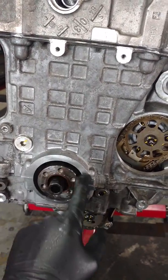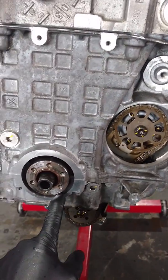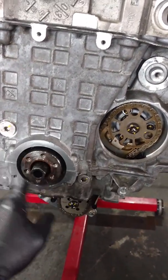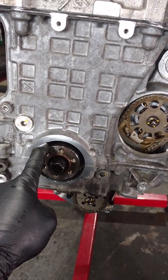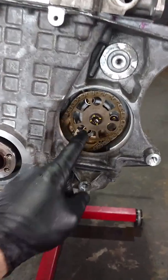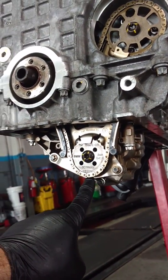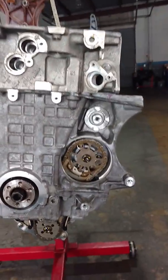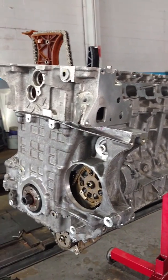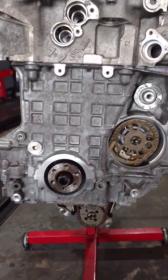When the belt breaks, it wraps itself around this crank seal and goes into the engine. There's a big harmonic balancer that sits on the face of this, and when it wraps itself around, it sucks down to the center of the seal and the seal gets compromised. The belt goes through there, and then the timing chain acts like hungry hungry hippos and sucks it into the engine. After it gets sucked in and goes through sprockets, it gets chopped up like a blender and plugs the oil pump up. If it plugs the oil pump up, we're going to damage the engine.